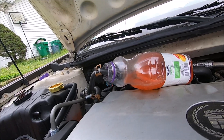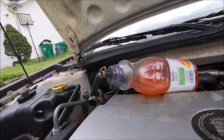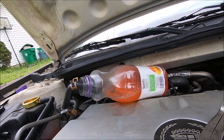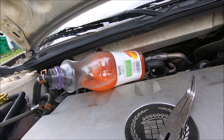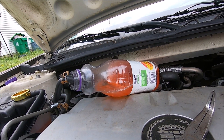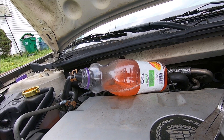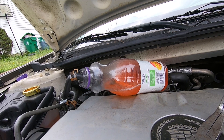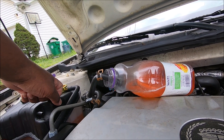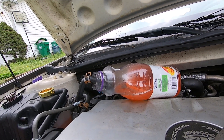Like I said, I don't believe there was too much air in there. Anyway, that's how you get the air out of your Cadillac Northstar. What I'm going to do now is close it up and drive it for a day. I'm going to keep an eye on this to make sure it's not low, because if it runs low it puts air in the system again.